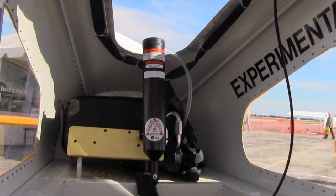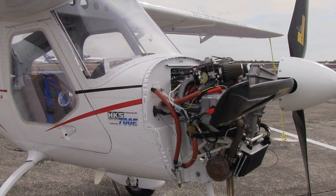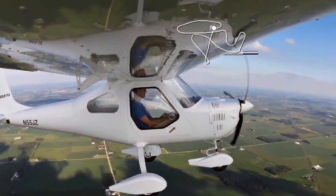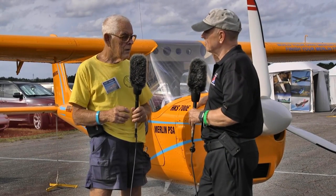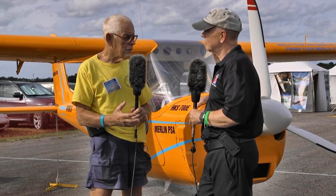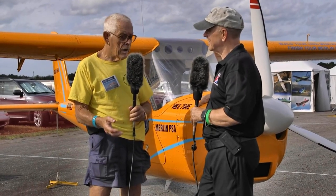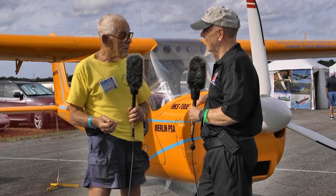Tell me about that evaluation. It comes complete, it's all deburred, everything's ready to go. You've got some false rivets in there holding the structure together. And you'll end up taking the turtle deck off because you want to do some plumbing inside. Those false rivets will come out but the rest of the structure stays in shape. Then you go ahead and do your plumbing, put the turtle deck back on, and you just start popping rivets.